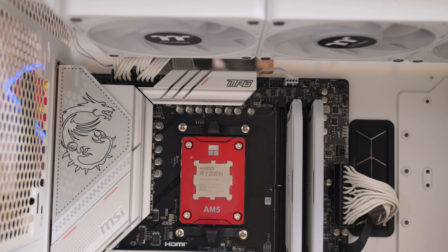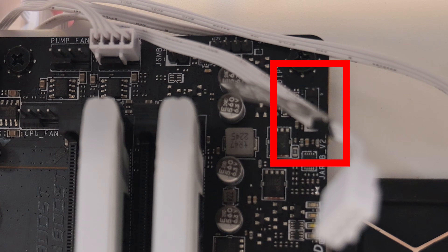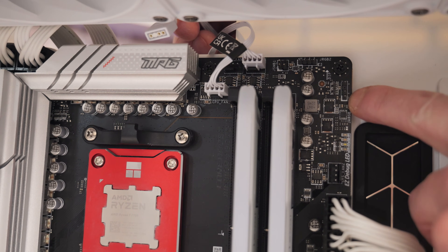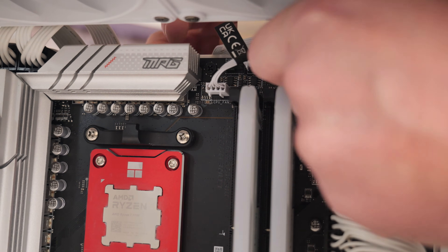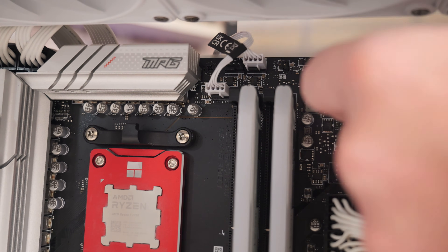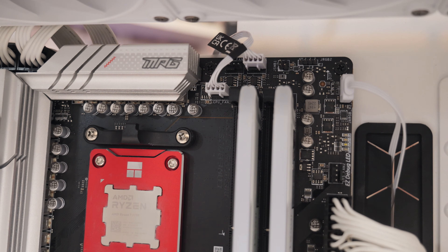So now we've got our cables passed through — we want to connect one of them to the CPU fan header, which will be highlighted on the video. The other one is the addressable RGB connection just at the top, which is slightly out of view at the moment. There's our CPU fan connected. Our addressable RGB connection is over on this side — you can choose whether to stretch it over along here, or this case has a pass-through just here which might make things a little bit easier. You can then tuck any of the wires out of the way just to keep things neat.